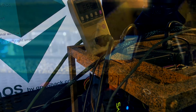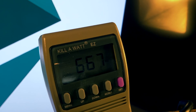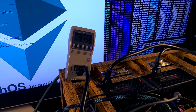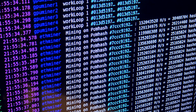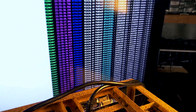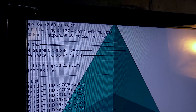For the long-term test using standard clocks - 1125 core with 1600 memory - these locked in at 127.36 mega hash for all six, which is really good for the 280X series. Pushing them to where they're really comfortable at 1200 core and 1875 memory, this rig locked in at 136 mega hash - unbelievable for a 280X. At those rates we're talking 1150 watts per three cards, over 2200 watts total. Dialed back to 1125 core it runs at 972 watts per power supply, and we ran it stable for nearly four days to prove it.